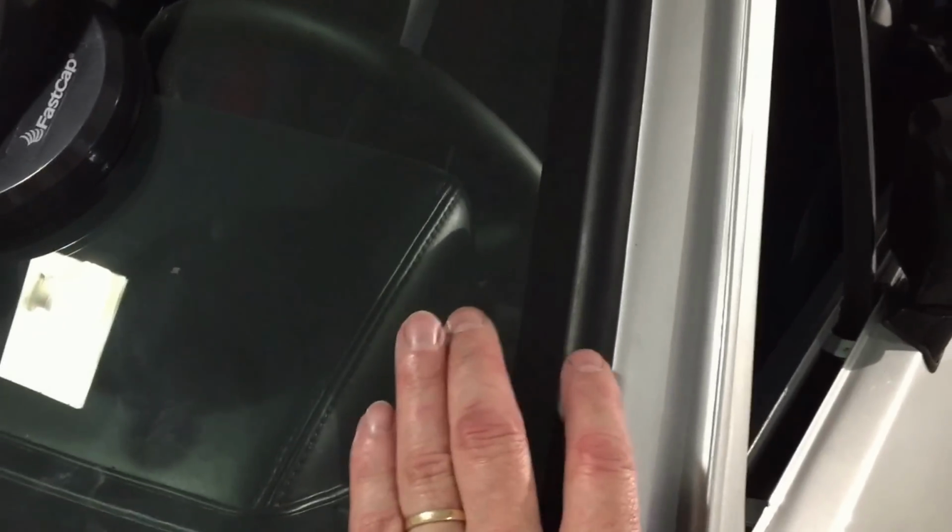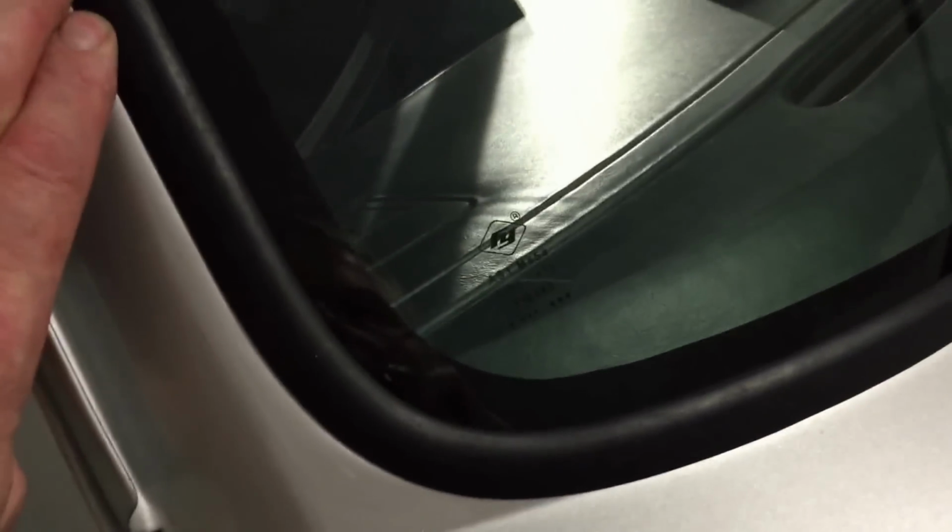So it actually looks really good. This is technically a 17 millimeter generic. I just measured it on the car like this, and it looks more like 18 than 17. But the next step up is 19, and you can see where the molding runs next to this guy. It's already almost touching. It's got significant overlap in the top and bottom, but on the sides it's minimal. So it covers everywhere on both sides, but barely, with maybe a millimeter to spare, maybe 2 in the corners, maybe 3 millimeters over here, but it covers it. And who cares, because it's glued in, right? So it's not like this is a seal issue. So it's going to look awesome. It's going to be good.